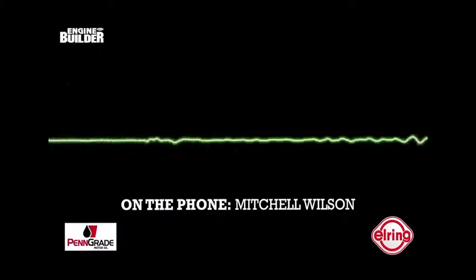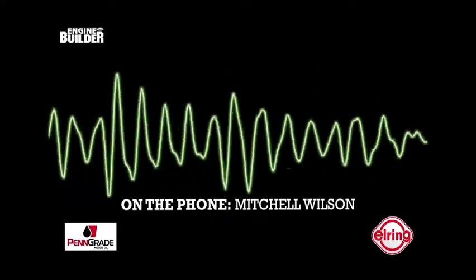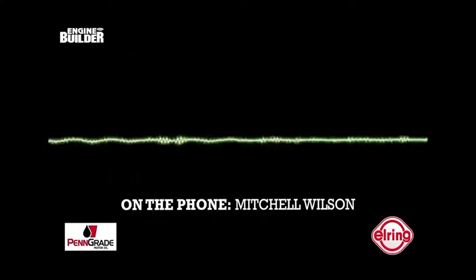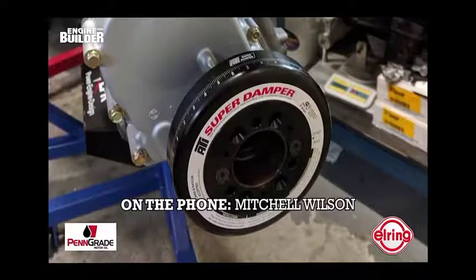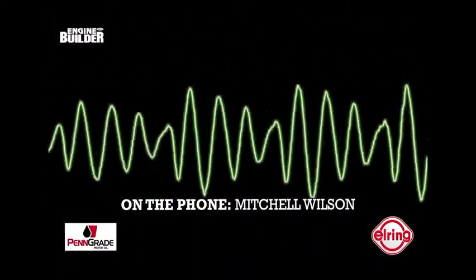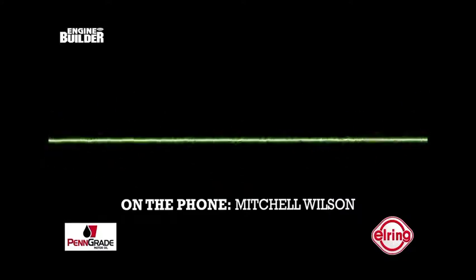One of the last things the shop did was develop a revised V-belt drive on the front. Wilson's business partner adapted Moroso V-belt drive pulleys from a small block Chevy. They also worked with ATI Damper to figure out dimensions on one of their Nissan dampers, buying a shelf damper and modifying it to fit the U-20 with no problem after modifying the hub. Jim Tyler from Datsun Restoration Parts supplied an aftermarket alternator kit that spaced everything out based on the new belt drive system.